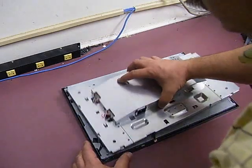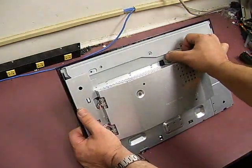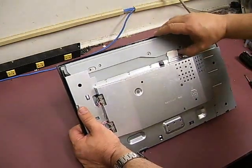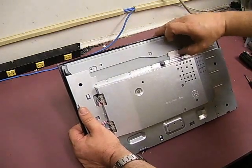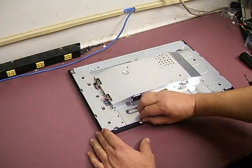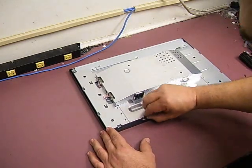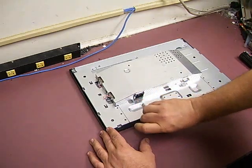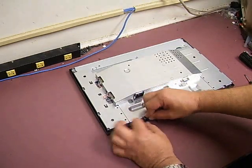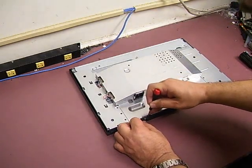Set the power supply in place. The next thing to connect is the display cable — it plugs right back into the slot it came out of. Then the last thing to plug in is the front display cable. Pull out a little bit of slack and plug it in place, using a small screwdriver to make sure it is well seated down inside its slot.